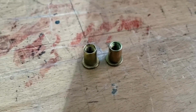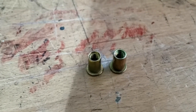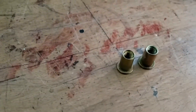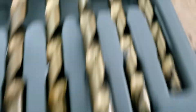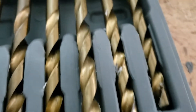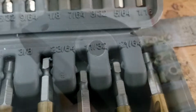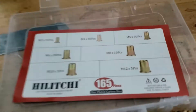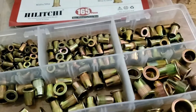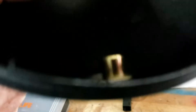We're going to use M6 rivet nuts — because A, I've got the appropriate length bolts matching, and B, because I can. The appropriate size drill for those rivet nuts is 23/64ths. Unfortunately the existing hole is already sized for an M8, so we're going to have to go large. Job done. Nice. That's that sorted.